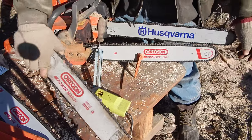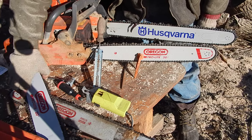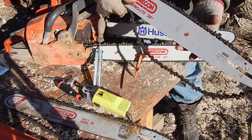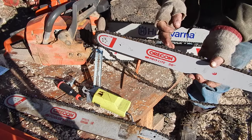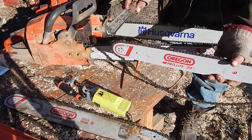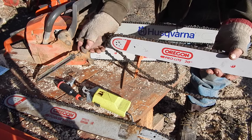In the ash it's no big deal. Rip chains have got a different angle cut on them — they're getting closer to being square across. This guide has got many different angles marked on it, so it makes it easy to keep track of which angle you're using for each chain type.